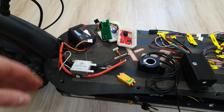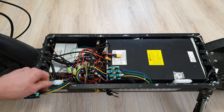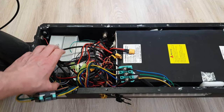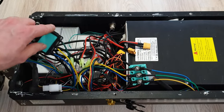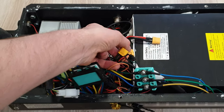For now, let's install VESCs into this scooter. Under the top cover, we will find a cable jungle and the controllers. The thing is that we have to disconnect every single wire and connector going to the controllers. Before you disconnect any connector, tag them so you will know how to connect them back. And of course, don't forget to first disconnect the battery from the controllers.